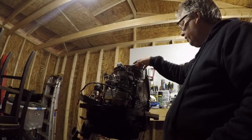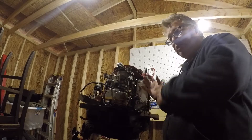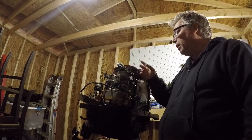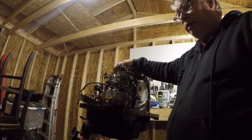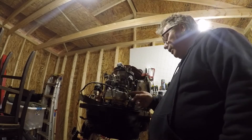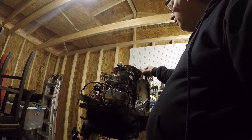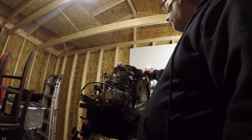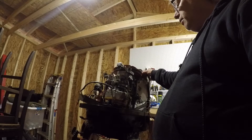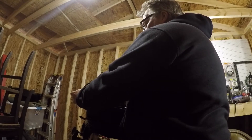In our earlier video I put the timing light on, checked all the spark, made sure I got spark on all cylinders. On number one I put a timing light, cranked it, and could see it was hitting at seven to nine degrees like it's supposed to. Now what I need to do is set the spark advance. I hooked up my meter, I'm at top dead center first — I rotate the flywheel to top dead center. My positive lead goes over to the switch box on the red wire.